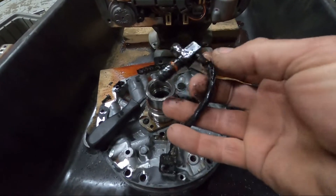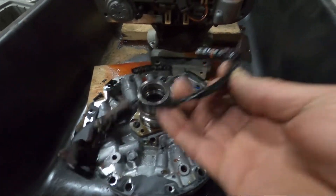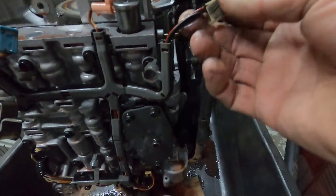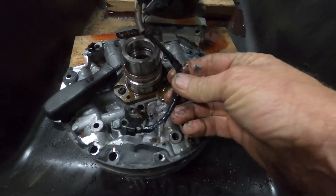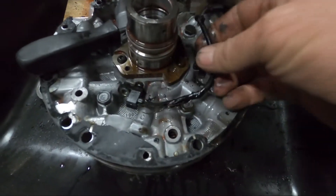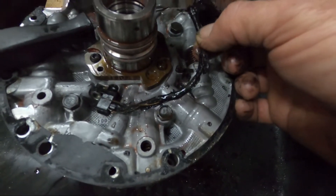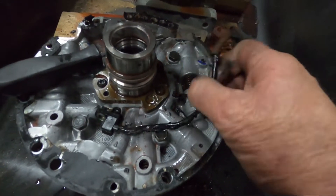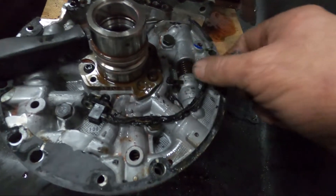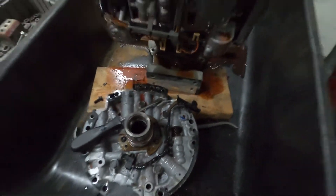The electrical in here is just baked — just cooked. It shorted in there and burnt the stuff out. The wiring on the harness itself is fine, which is strange. There was one spot where it goes in and reads off the shaft, and a little metal clip holds it — that's where it was shorting. Real genius engineering: instead of a plastic clip, they used a sharp stamped spring-metal clip, and that cut into the wire, shorted it out, and apparently that was enough to burn up the wires.